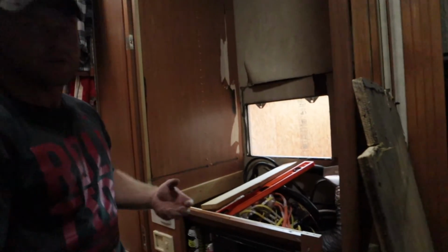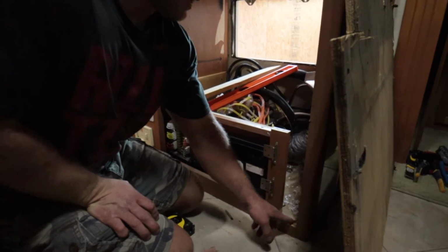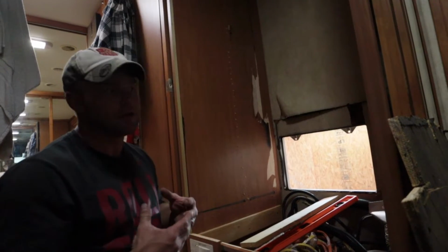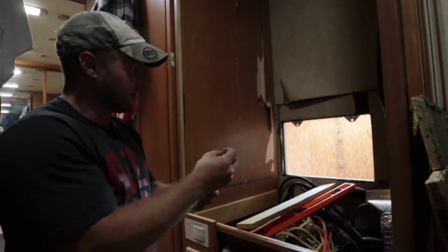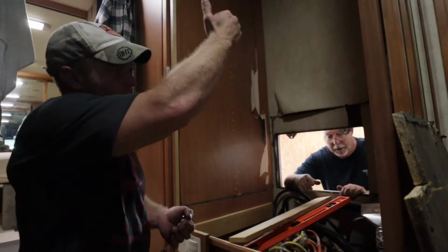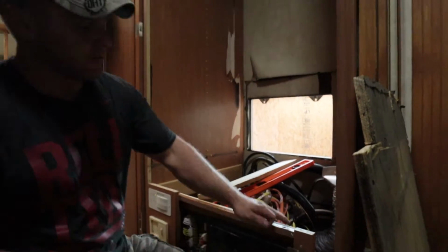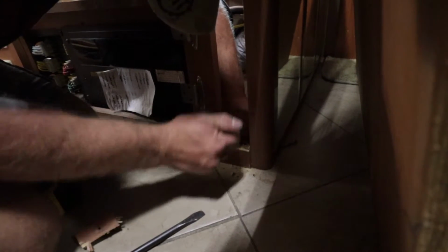The NorCold refrigerator. So you were saying that over there, that thing you just cut off, it got wet once. Yes, it's been wet. NorColds, when they go through a defrost mode, the pan's bad to stop up, and the little nozzle that it drains down in the hose is bad to stop up also, and it'll backflow down the back side of your refrigerator. It'll come out on the front. You'll never know it. If you have a NorCold, you need to keep an eye on that line to make sure it's not back feeding water down the back side of your refrigerator.